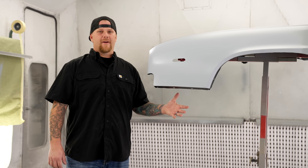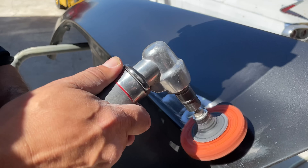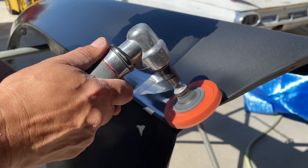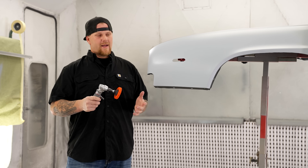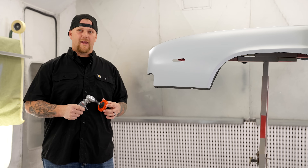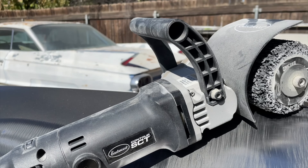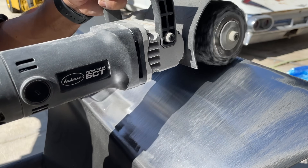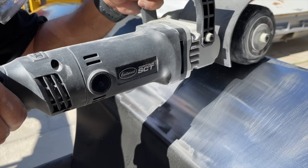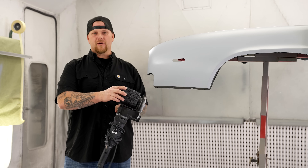We started by preparing this fender by stripping all of the e-coat off the face of it. We used a die grinder with a 3-inch strip disc. You can get strip discs from different manufacturers — they are good because they remove the material and any body filler or paints, without taking off any metal to make the fender thin. You can also use the SCT sold by Eastwood, or find them at Harbor Freight. They come with a barrel drum. This is the 40 grit — even though they call it a 40, it's more of a strip disc.